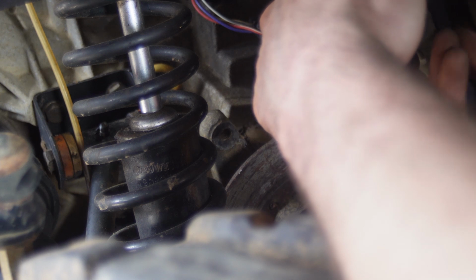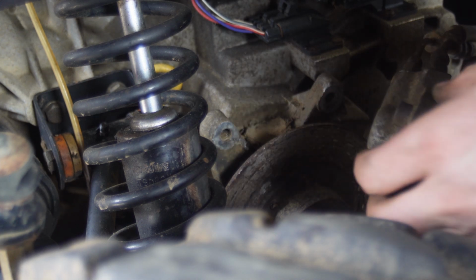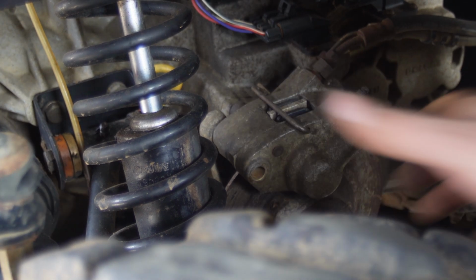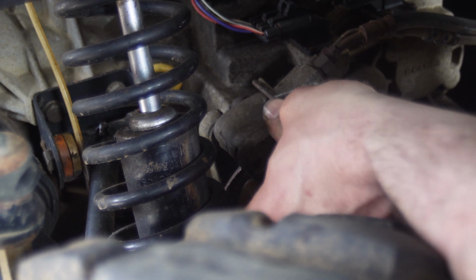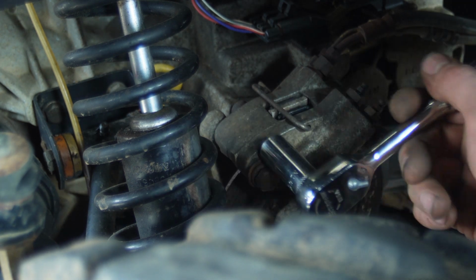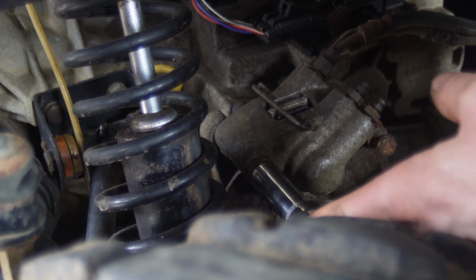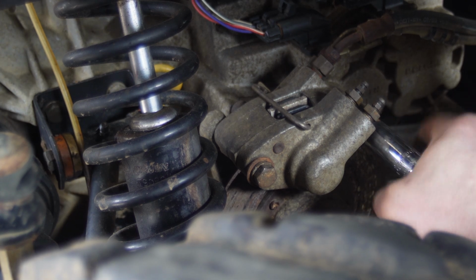Slide the pads in. This is where that block and clip come in handy. All right. That wasn't horrible. These bolts have me a little concerned, but they were working before, so I'm just gonna send it. They should, in theory, tighten all the way down. Looked like they were halfway out when I started. Someone probably forgot to put their bolts in. So I guess we can be a little better than they were.